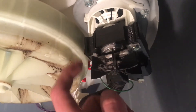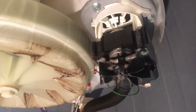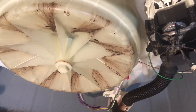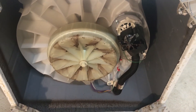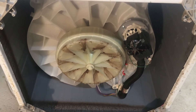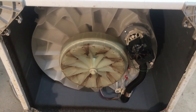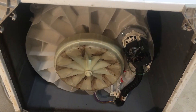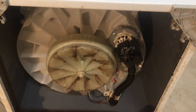Check the drain pump and test its resistance. If you've got a can of CRC, put a touch of CRC into the bottom and upper brass bushings — they can get a little squeaky sometimes and that will quiet them down. We also want to have a quick look at the RPS. On earlier machines with a plain PCB on the RPS we can pop the rotor off and look on the side of the PCB. On this one we want to look at the plug — check what corrosion is on it and whether it needs replacing with the full sealed harness RPS.